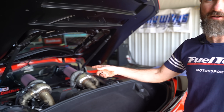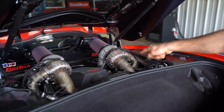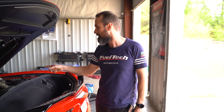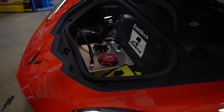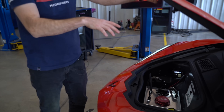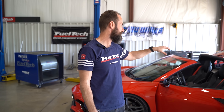That's a pair of G35s, 900 each — Garretts. We are running an intake manifold with 8 injectors. Currently we have 8 of the 1700cc injectors on this car. The FuelTech is controlling the port injection. We have a fuel cell on the front from Aeromotive — it's a 5 gallons per minute pump and it fits right in on the front of this car. We decided to run a completely separate fuel system, so the FuelTech is controlling the separate port injection fuel system, making sure all the electronics on this car are still happy.